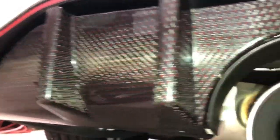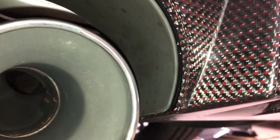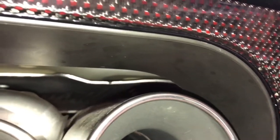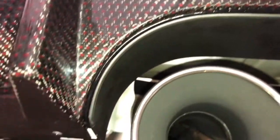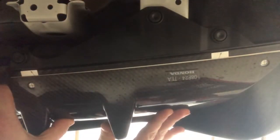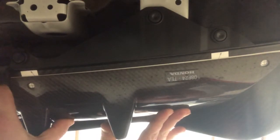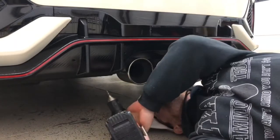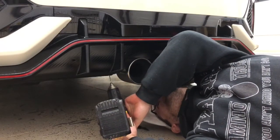Using the reverse side of the stencil, everything lined up perfectly on the driver's side. The side with all the writing didn't line up exactly, so I did need to make those holes a tiny bit larger to get everything to sit flush — which was important so the 3M tape adheres all the way around as designed. Now I double-check the third stencil, move it until both crosshairs line up in each hole, mark those holes, then drill the bottom side of the bumper with pilot holes before going to final size.